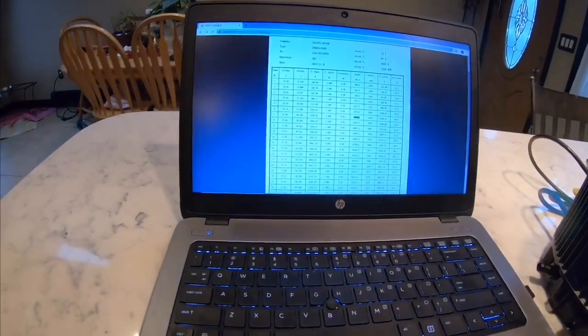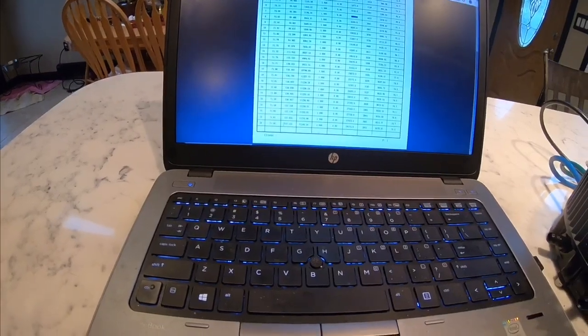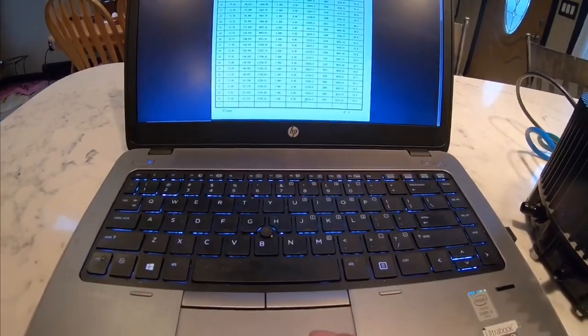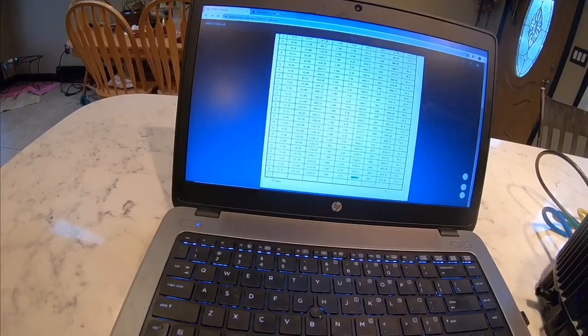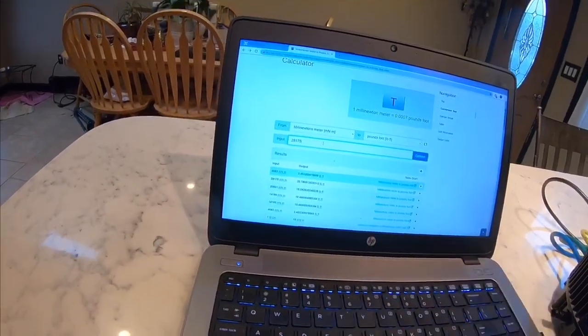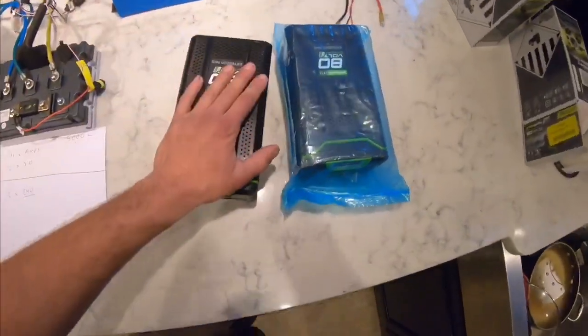If we go to the motor datasheet and scroll down to the bottom — if we do even 157 amps, that gives us a torque rate of 28,175 milli-newton meters. Converting that to foot-pounds gives us 20 foot-pounds. I think 20 foot-pounds is enough to get the go-kart moving — that's a nice amount of foot-pounds. This is all in my head in theory. I don't know if it's realistic, but that's the whole point of my channel: to experiment with this stuff for you guys to watch and learn together, and see if it actually works — or I record the whole thing catching on fire.